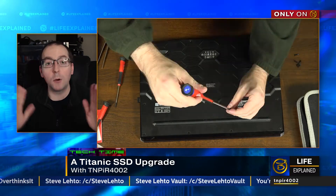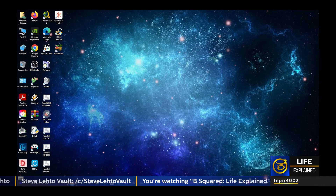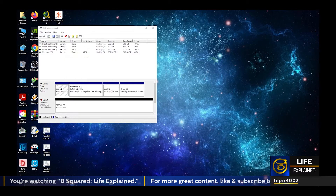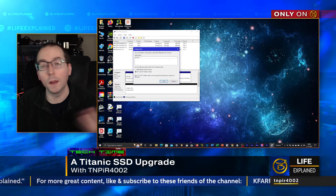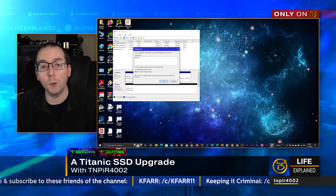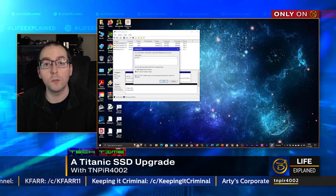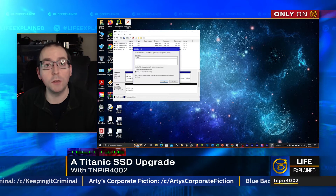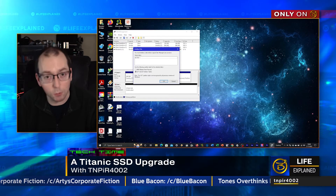After that, I powered the Raider back on. At first, Windows isn't going to pick up the new drive, but don't panic. All you have to do is open Disk Manager, and it should prompt you as to whether you want an MBR or a GUID partition table. Modern drives operate better with GUIDs; MBR is there for legacy drives from the late 90s or early 2000s. I went with the GUID partition, it showed unallocated space, and from there all you do is create a new simple volume — and voila. I had a perfectly usable drive, easy peasy, ready to be filled up with all sorts of useful and, knowing me, useless data.